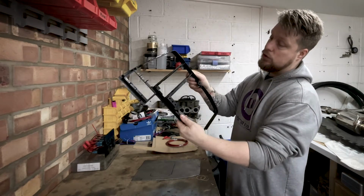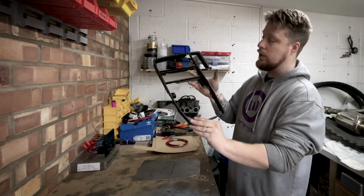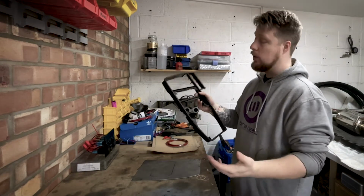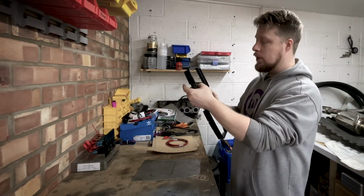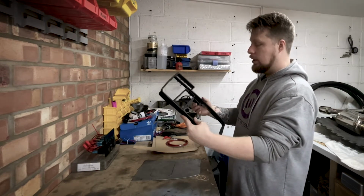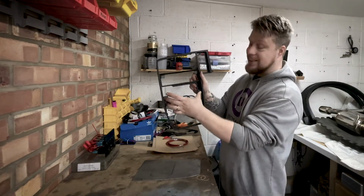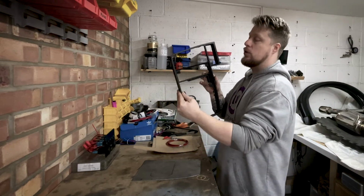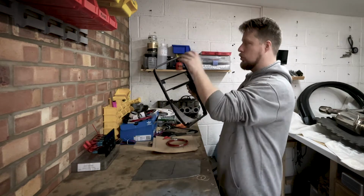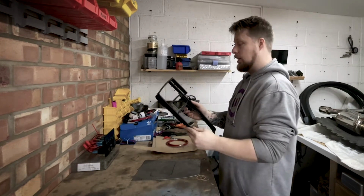And all I've done is just gone around and plastic welded them with a soldering iron just to itself. It's the same plastic, so it'll melt really well to itself. They are quite sturdy. I don't want to push it, but they are quite sturdy. And what that enables me to do is remove that panel and still keep the original mounting holes. So this will go in first, the panels will come in afterwards, and then I can reach behind, get to the wires and everything like that.